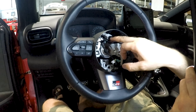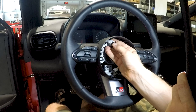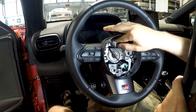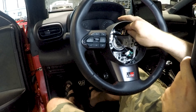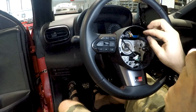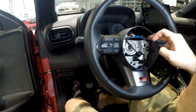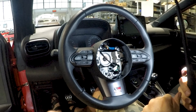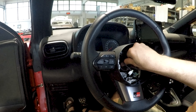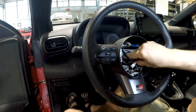That is the steering wheel connector which you connect to our wiring harness and then push it gently into the slot behind the steering wheel. There is some room — gently make it go in so you are not going to force it, because in a short while you are going to insert the airbag and you don't want any wire to be pressed. There is enough room for everything — please use it.